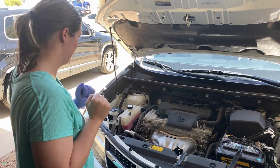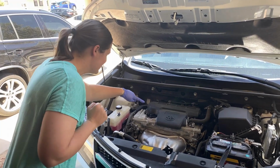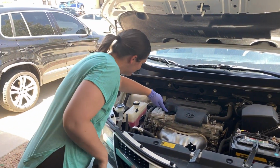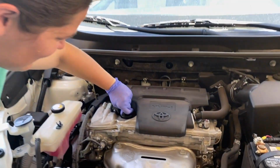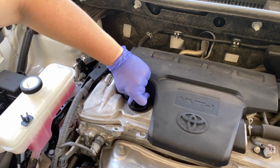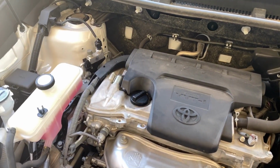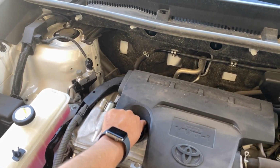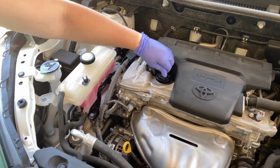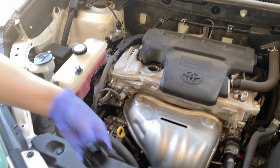Open the oil cap, remove it. Which is? A cap that usually has oil written on top of it. It said, be nice. And why are we doing this? That's so that when you're draining it, you can get a better flow of the oil coming out of the oil pan. I'm weak, Juan. Okay. Thank you. You did it all. Just put that off to the side. You can just like right up here.